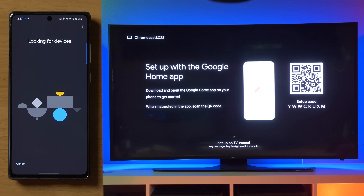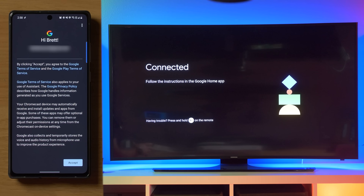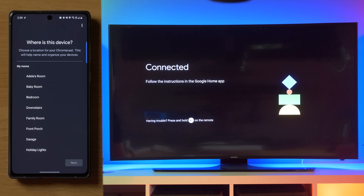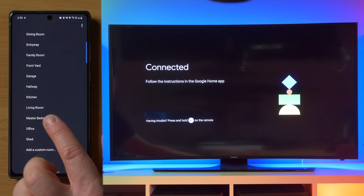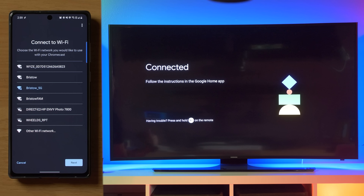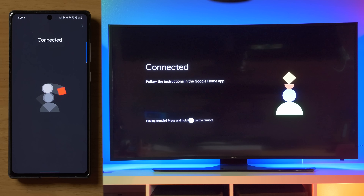Here we're going to choose what home we're going to add this to. And now it is looking for a new device. So it found our new Chromecast, and now we're going to use our phone to scan the code on the screen. It is now connected here, it is linking with my Google account. It's asking us to read through the privacy policy statement. And when you've done that, we're going to accept. And now we're going to agree to additional legal terms. Next, we're going to choose where we want this device. So I'm in the office right now. If you want to put this into a new room, if you scroll all the way down to the bottom, you do have add a custom room. And then next, we're going to choose the Wi-Fi network that this will connect to. Now it does have five gigahertz or 2.4 gigahertz — I would choose the five gigahertz if you have that available. And then we're going to type in our password.